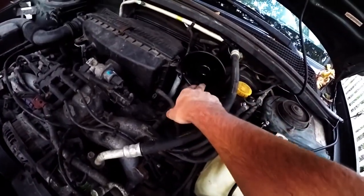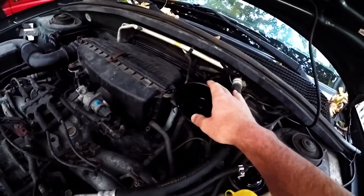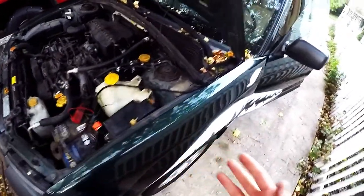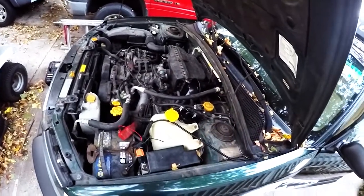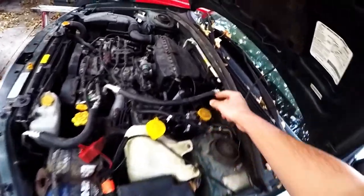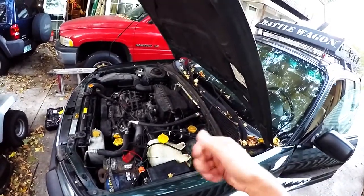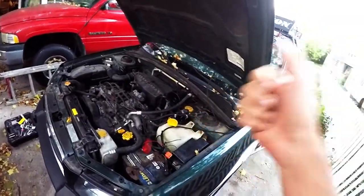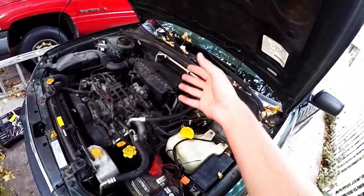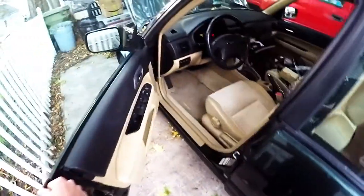And no, I didn't actually leave this thing just sitting open in the engine bay. What I did instead is I punched a hole in it using a utility knife and then just zip tied it to a bunch of things around. There was no good place to put it where I was comfortable it wouldn't be exposed to heat. So instead I figured I'll just leave it zip tied out of the way so that if I do need to remove it — rather than bolting it, since this is a really cheap flimsy frame and even just trying to zip tie it I ended up bending it — I figured zip ties I can just cut off if it gets in my way. That makes it very easy and quick to get it out of the way or reinstall it, and I don't have to worry about dropping bolts through to the floor, which I managed to do every time.